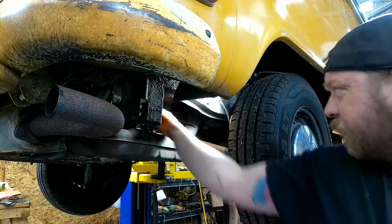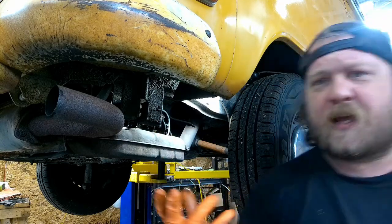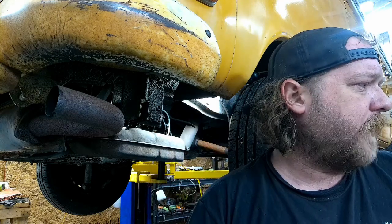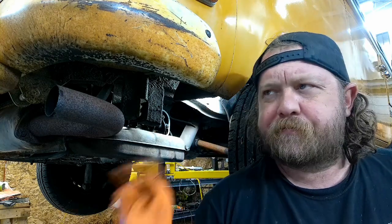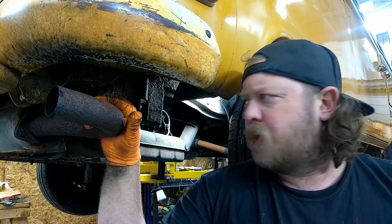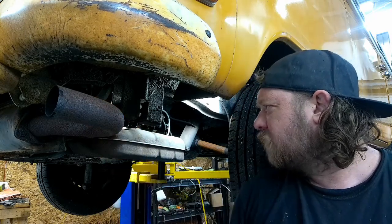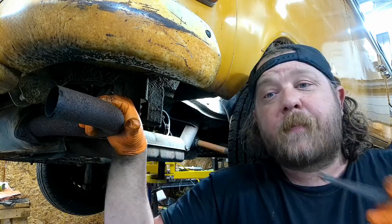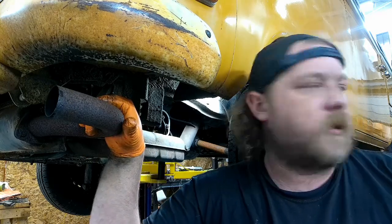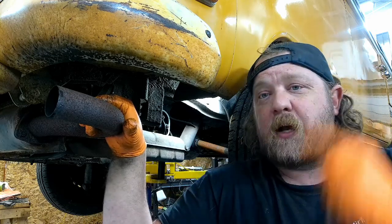But let me go through and adjust these. Other side, about the same, knocky on them. Exhaust 3, super tight, probably about 4 thou. So that could be the reason. That is backing out. That's a Home Depot bolt. Anyway, that could be the reason for the dieseling. Not just one cylinder, but could be a cause of it. So let me go through, finish up doing all these valves, and I'll get back to you.